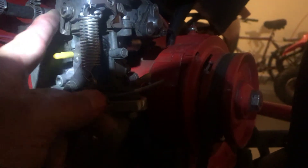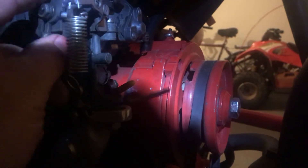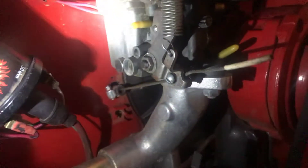At the carburetor — everybody messes these up. Right here you've got a screw that is for the choke only. This choke rides on that screw. When the engine is fully hot, that screw should not touch at all. That is not the idle adjustment screw — everybody thinks it is, but it is not. The idle adjustment screw is this big fat one right here.